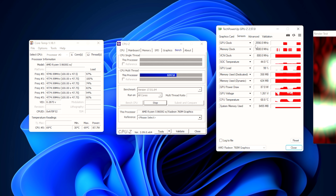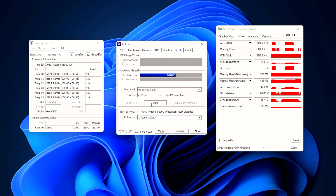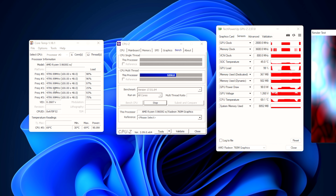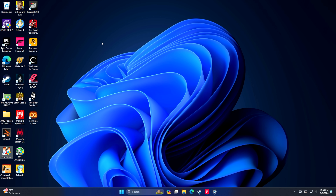Our GPU is not running at 2,800MHz yet, so there are ways around this. With a bit of tweaking, stressing the CPU shows around 50 watts, and once we put a load on the GPU you'll see it jump up more — we're at around 90 watts, with the CPU at around 4.8GHz and the iGPU at 2,800MHz. So maxed out on both CPU and iGPU, this chip pulls anywhere from 90 to 95 watts. Remember, games aren't going to max out all six cores and the GPU simultaneously — I just like running that test to see what it can pull.